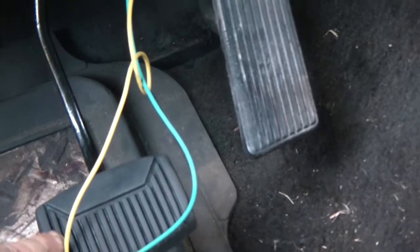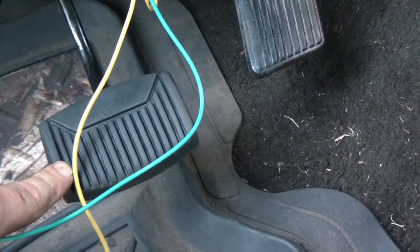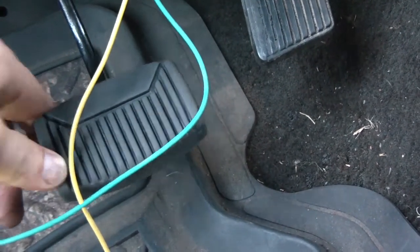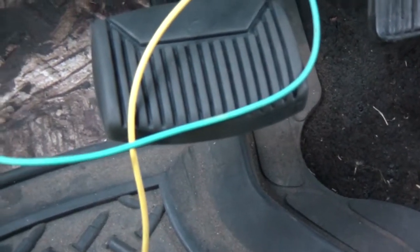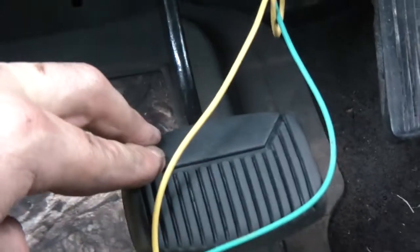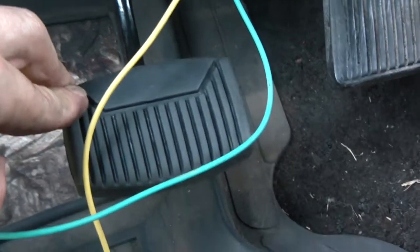I think I've got it — check it out. My multimeter right there, brake pedal — barely touching it, and as soon as I touch the pedal the light comes on. As soon as I touch that pedal, boom. It's not perfect — it's kind of a weird design. It seems like a seriously unreliable design. I guess I like the idea of the pressure switch better, but it just doesn't last. Maybe they make a better pressure sensor, but this is how they came stock after '66.